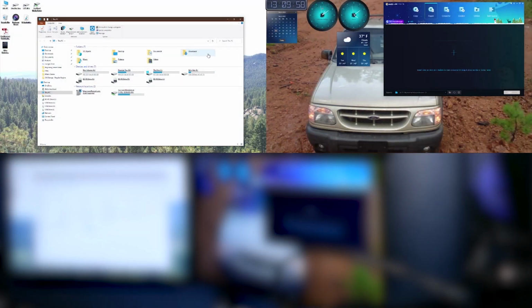Before we get started, the problem I'm having right now is that when I put a DVD into this drive, nothing happens anymore. It doesn't recognize anything's in there. When I hold my ear up to it, I can't even hear it spinning anymore. There have been no changes to this drive, no software changes, no operating system changes, and one day it just quit working, which leads me to believe that the DVD drive itself has an issue. Also, couple that with the fact that the DVD doesn't spin, and it means the drive isn't even recognizing that there is something in it.